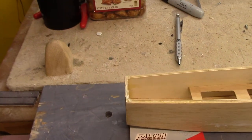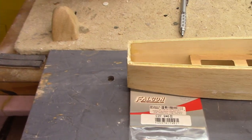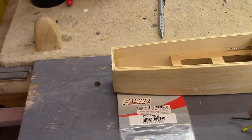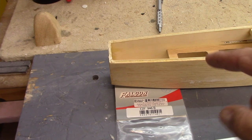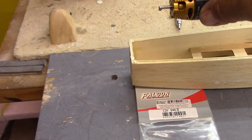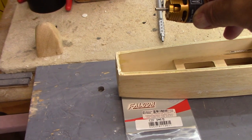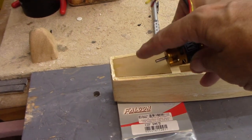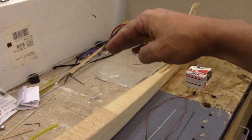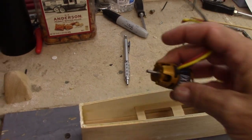I'll probably put two degrees of down thrust, and I don't have to worry about any right thrust. That way if I have to throttle up to transit to a different spot where the thermals might be busting out — if I lose lift — I'm not trying to fight the plane porpoising up and down. I went over to my friends at Max Products because they're local, got hold of Tom, one of their sales guys, and they had everything in stock. I'm going with a 40mm spinner, which should fit very nicely on the front. I also got an extra collet — don't really need one, but they're cheap, like three bucks, so it's always good to have a spare.